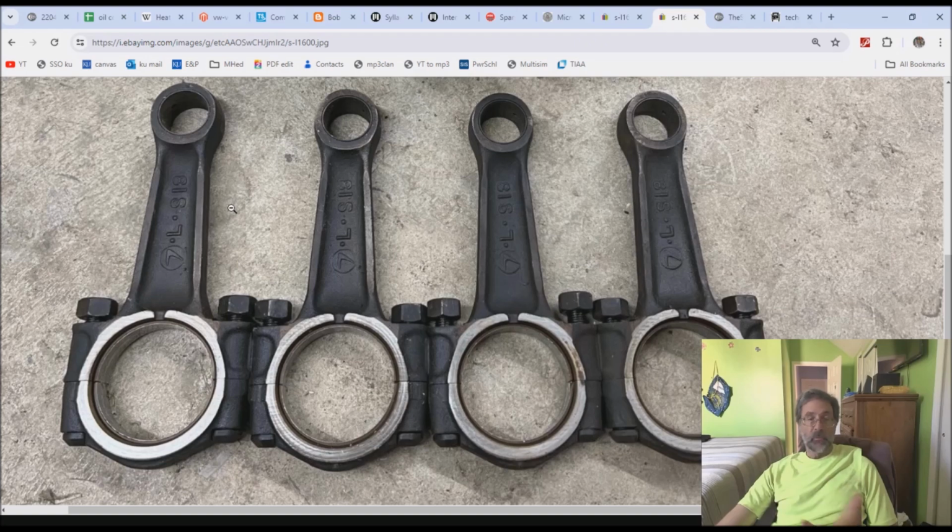Okay, these happen to be, once again, Subaru components. It is not an afterthought. Those little holes right there are in the casting, so they are cast like this. Subaru is not the only manufacturer that has done this. It's not even a recent modification. In my reading, if I remember correctly, there were motors as far back as the 1930s that had this particular modification done to them. So it is an old and well-known modification for cooling the piston.